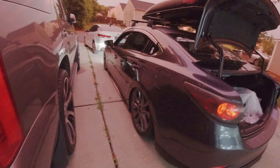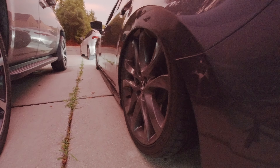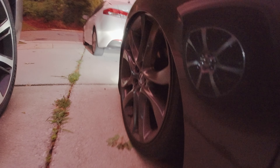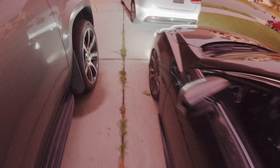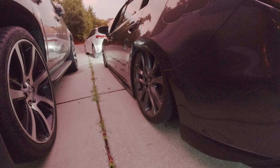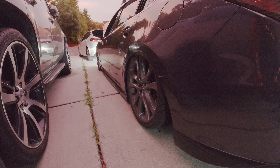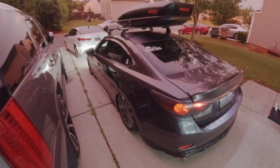Here it is. This looks a whole lot better — that 20mm made a whole heck of a difference with the fitment of these factory wheels. For $75, you can't go wrong. These factory wheels look good with a little bit of paint and some spacers. So until next time — think, build, enjoy.